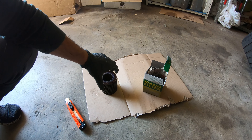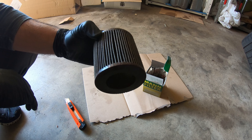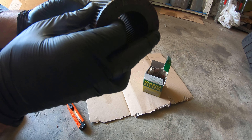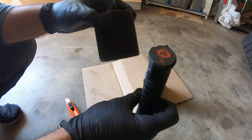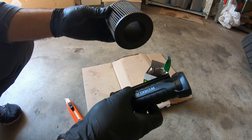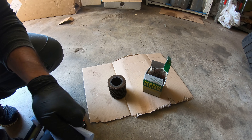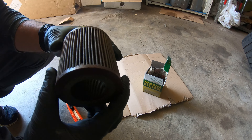It is the next day. I have the oil filter that we're going to cut apart and take a look to see if there's any crazy metal in here. I have my light here, and the light has a little magnet on the bottom — we'll be able to run the magnet over it and see if we pick up anything. This won't pick up aluminum of course, and there is aluminum in our engine — the block is aluminum, magnesium alloy — but at least this will give us an idea if our engine is chewing itself apart.